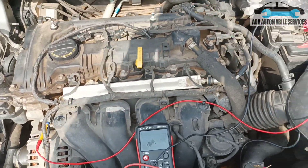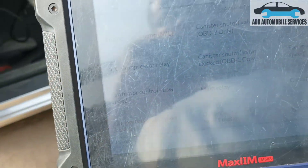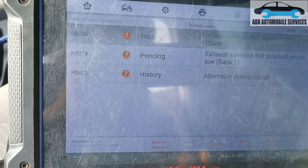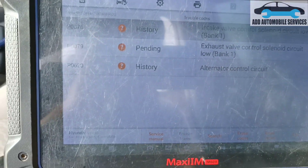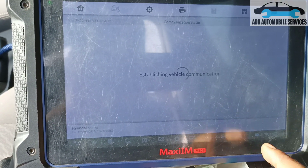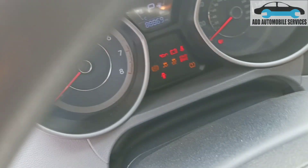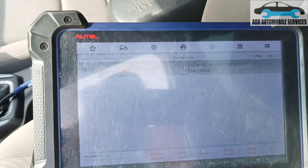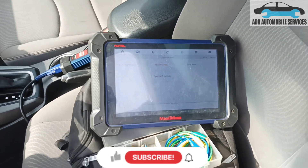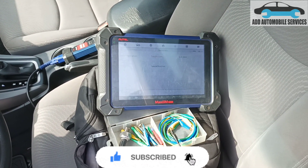Now that I've given it power, let me stop and go read the fault code again. The fault code I'll be getting will be a history fault code now. Going back to fault codes — I'm having a history: the intake fault code is history because I've given it power. If I erase it and scan it again, only the exhaust code will appear. Recycling the ignition and reading the fault code again — I'm getting the fault code on the exhaust only. That means the power side is my issue on one side, and the other side is losing the control side. I'll do the diagnosing properly, tell the customer the issue, and if he's willing for me to repair it I'll continue with the video. Thank you for watching — subscribe to my channel for more videos.